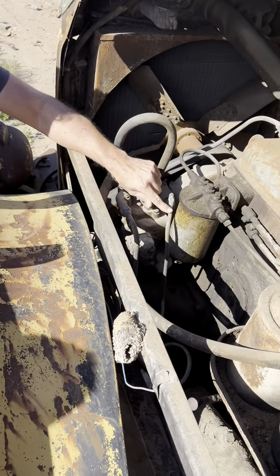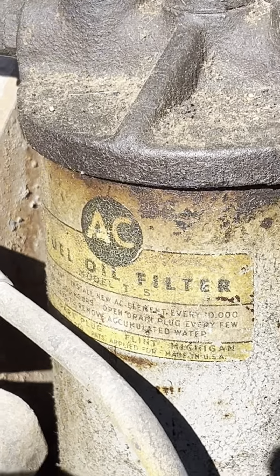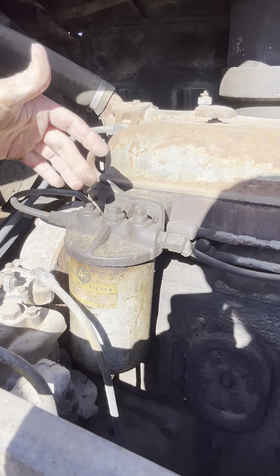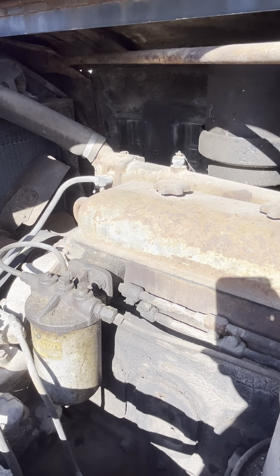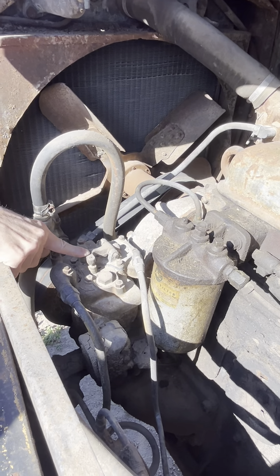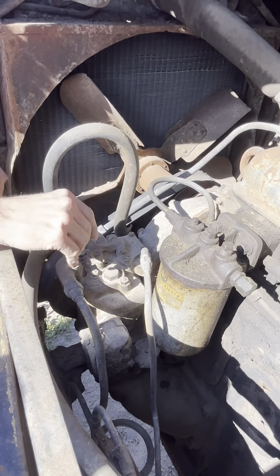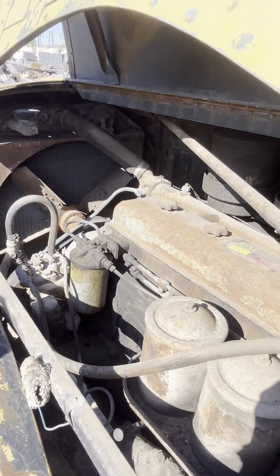Here we are on the left side of the hood. Here's that beautiful fuel filter decal — this thing is gorgeous. I saw it 30 years ago and took all my measurements on it. Because Roy sent this whole cover to me, the back side has one also, but the back one is very deteriorated compared to this one. This one's complete, even still 30 years later. Original air compressor — air compressor with the external unloader valve. A lot of times compressors would be replaced with a newer one that has this unloader valve which dumps air once you reach full pressure, all contained inside the head with a smooth head on top. So this is an older compressor — it's probably the original one, definitely the original style.